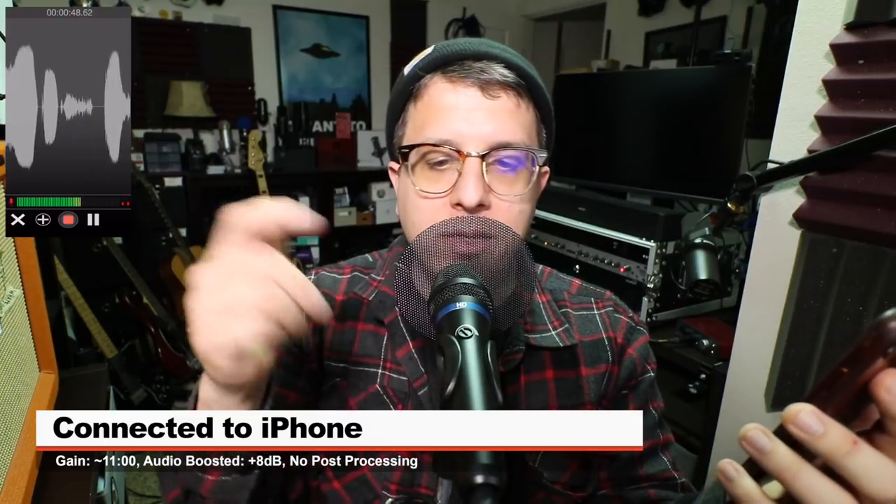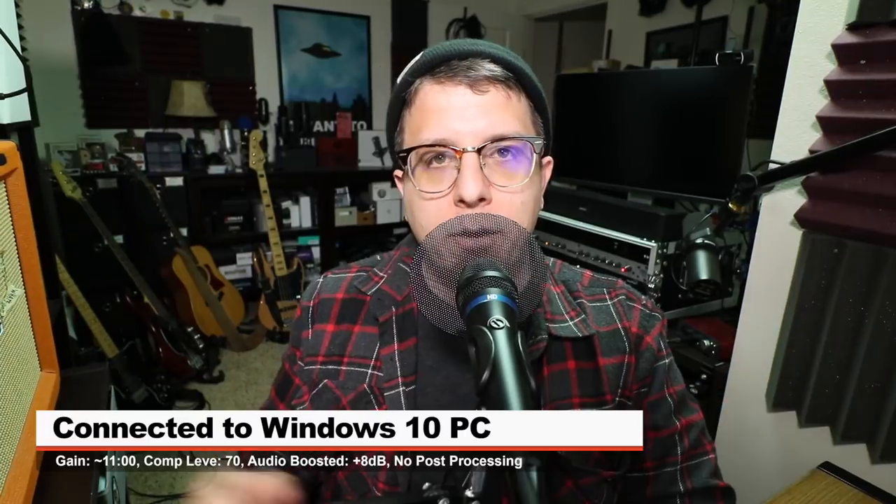Now I'm recording the microphone directly to my iPhone 10 using the IK Multimedia iRig Mic Recorder app. If you want to export your files as WAV you do need to pay for an upgraded version — keep that in mind. I am recording at 24-bit 48 kHz with the gain at the exact same setting, and this is how the audio sounds on iOS.